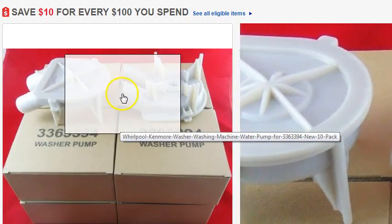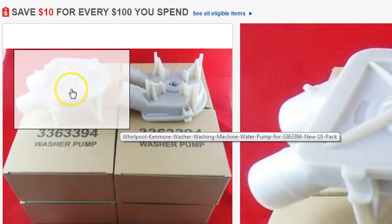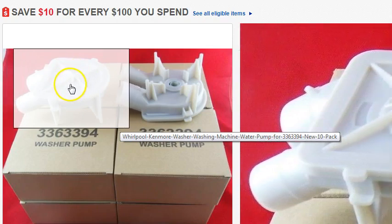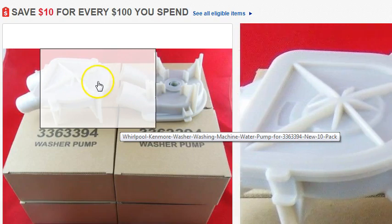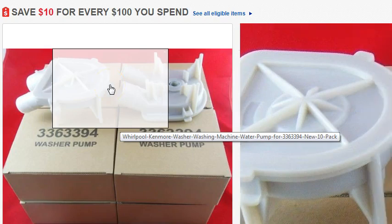Scrolling over — the pump itself has a plastic backing you see on the right half of this image. As the sock binds up inside there, it will cause compression to occur, and that pressure is going to crack this case and cause leaking in the pump. The other thing is that small items will go through the washing machine holes in the tub — like screws, earrings, nails, nickels — and when they get into this area, they will cut a hole right through the pump and cause leaking.